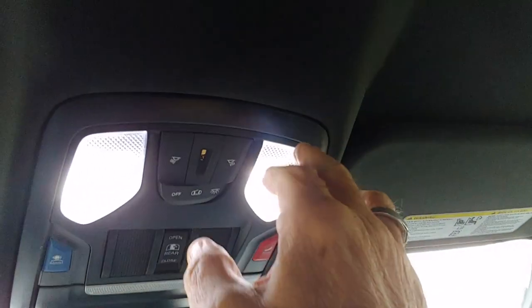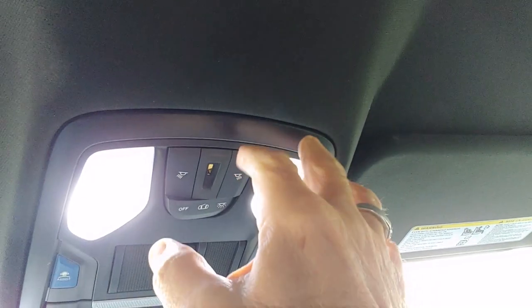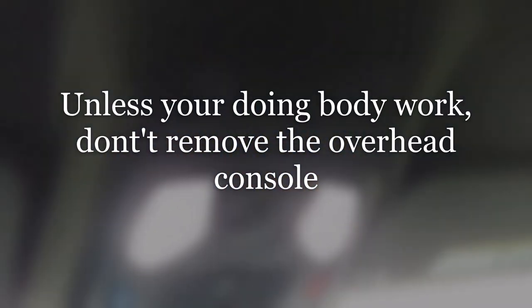The big problem is when you get up into here. They want you to pull this out. There's two clips in there. Those clips, while they may be reusable a couple of times, they slide into a couple of slots through the frame, and if you just jerk those out of there, you're gonna cause this to loosen up every single time you do it.